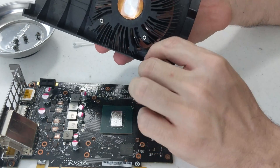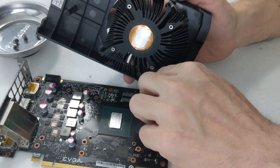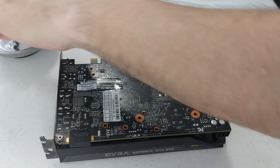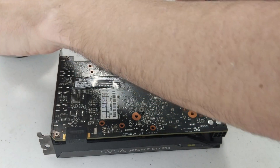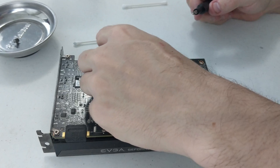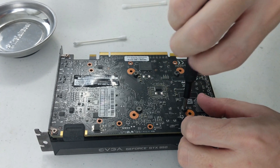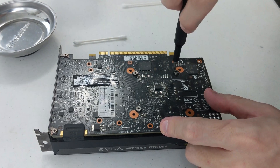Now we're going to plug the fan back in. If you can see here, this little fan connector right here — plug it back in. Then it's just a matter of placing the two back together, like so. Take your screwdriver, grab these screws out of your magnetic parts tray. Don't tighten all the way — just make the first two across from each other in an X. Don't tighten all the way, just make sure it grips — you want to feel the threads bite. Do that for all four screws. Once you're done with the last screw, go ahead and tighten all the way, then go back in an X across. Come back over here, tighten. Come back over here, tighten. And that is it.